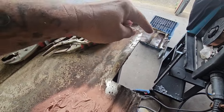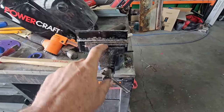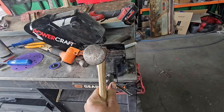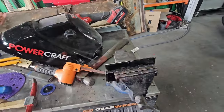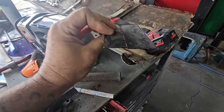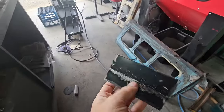Just doing this edge here as it curves in. The way I do it on these smaller jobs - I like the smaller vice because it's easier to work with when you don't have much room. I could use a pan brake but I like to just smack the hammer with that edge, straight in like that - obviously harder - and it creates that edge. As you can see it's starting to form there, just go back and forwards - that one probably needs a little bit more.